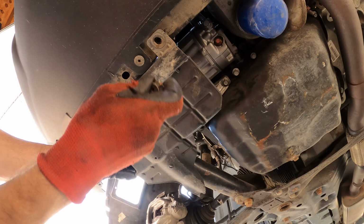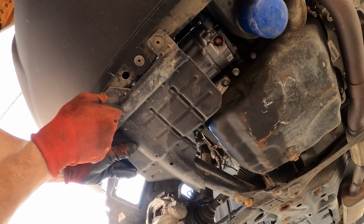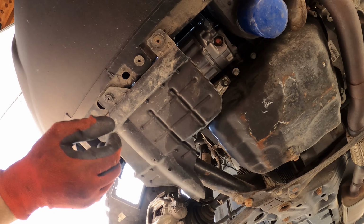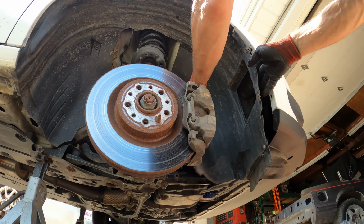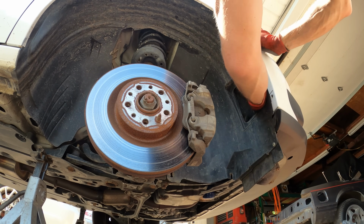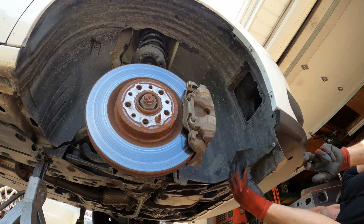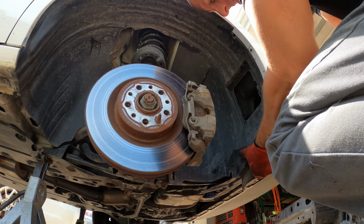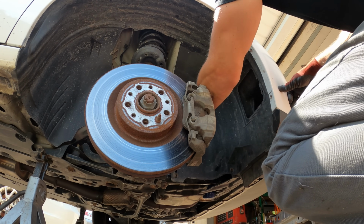Also, the first splash shield on. If we can figure out where it goes. Start our bolts. And tighten them up. Now we can put our wheel liner back in here. Fold it up. Stuff it behind the bumper. And stuff the bottom of it up on top of the bumper. One tab of the wheel liner that goes into that lower valance doesn't want to cooperate. It's going to. We got it behind there.